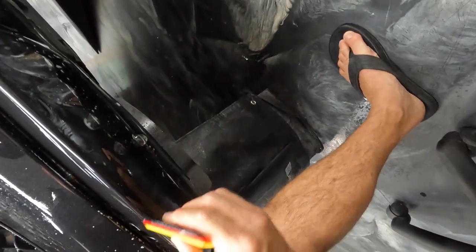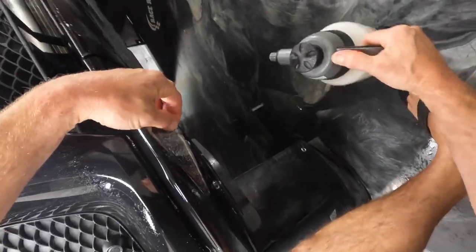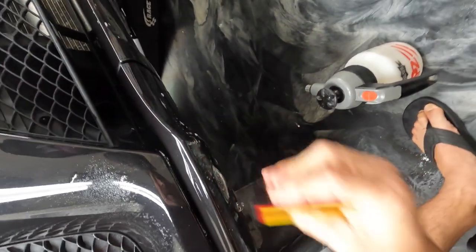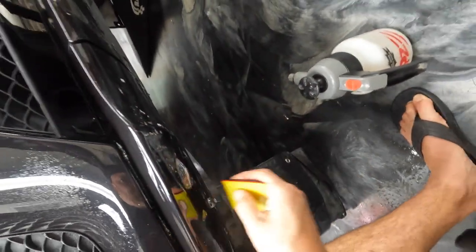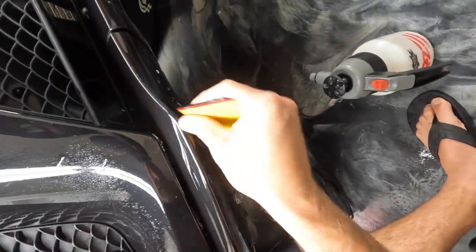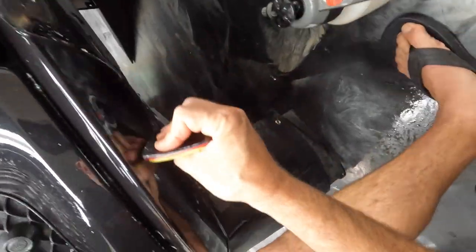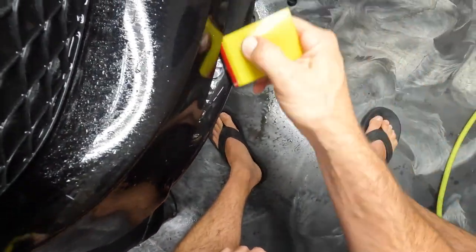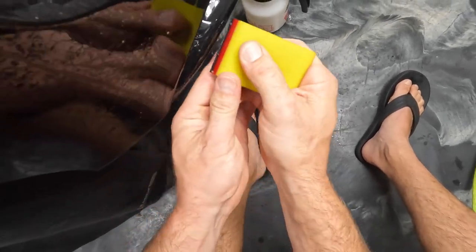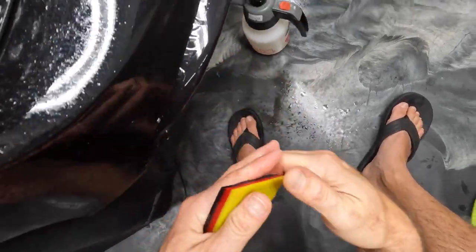So I'm gonna put a little stretch on this here. What I'm doing is stretching towards the back of the car, as well as stretching a little bit towards the center, so to the right. And that's going to help me get rid of all those fingers that were there. All right, we'll get a little bit more rubbing alcohol in here, and then we'll push down all these fingers. Well, at least I think I'm going to put some tack solution in there. Yep, there it is.